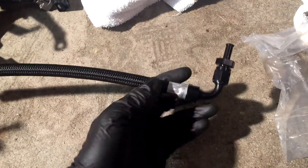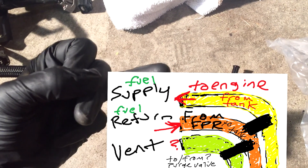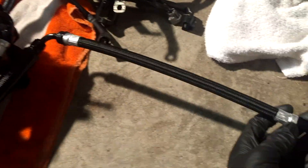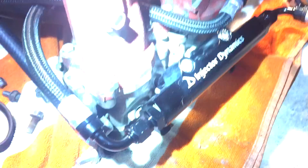This is going to attach to your 5/16th supply line, which would be the top line on that tree of fuel lines — we have supply on top, return on bottom, and then there's a purge valve or something that goes to the blue connector, which is the bottom line. I'm going to have to extend that because we no longer have the stock setup, so I'll cut the 5/16th line to accommodate, and use the original 5/16th fuel injection clamp.